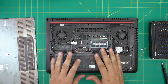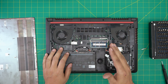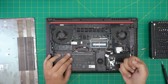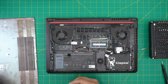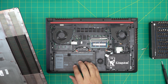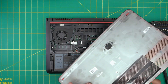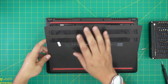After five to six hours of charging, disconnect the charger and use a light load on the CPU to slowly drain the battery all the way down, then shut it down. Put it on charge again for another five to six hours. This charge and discharge cycle is really good for the first use — it exercises the battery cells and gets them working properly.